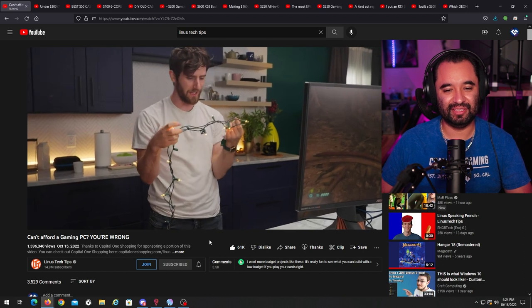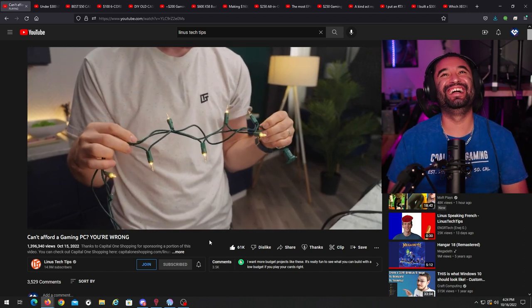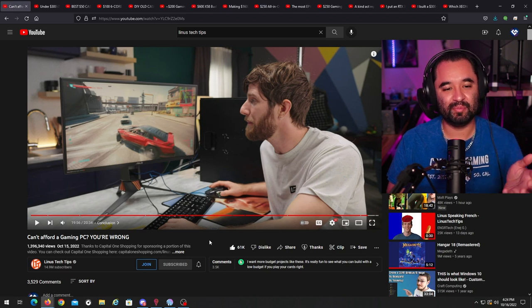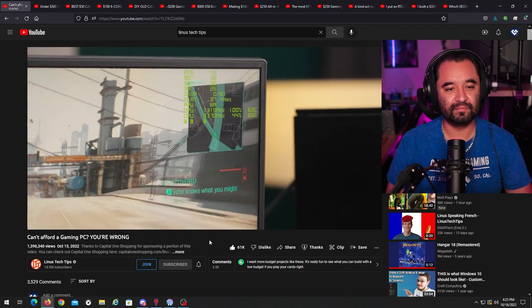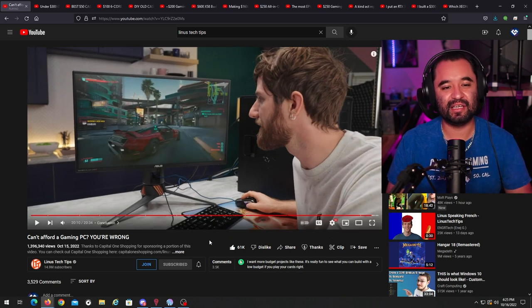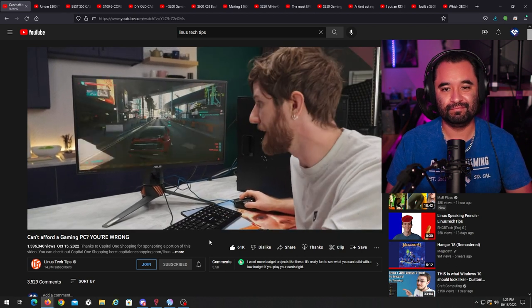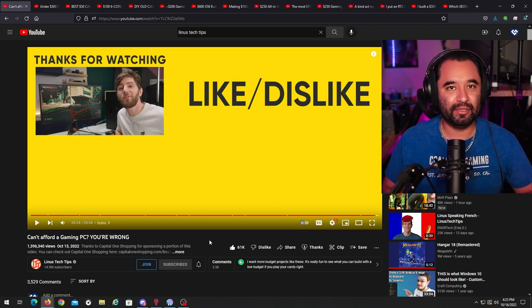He was told he's getting $50 in RGB lighting. At this budget that would be a pretty stupid thing to spend another $50 on. Actually, if you had $50 left and the GPU was around $80, that puts you right into GTX 1070 territory on eBay, which is a massive performance uplift over an RX 580 or GTX 1060 - so put the money into a better GPU. Average around 43 FPS in Cyberpunk - that's about the same result I got with the RX 580 and Xeon E5-1620.